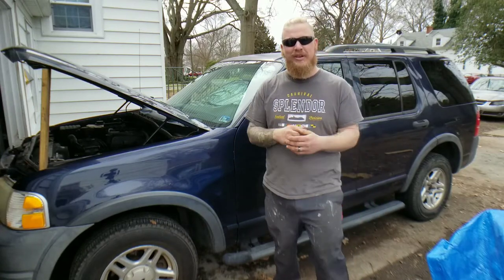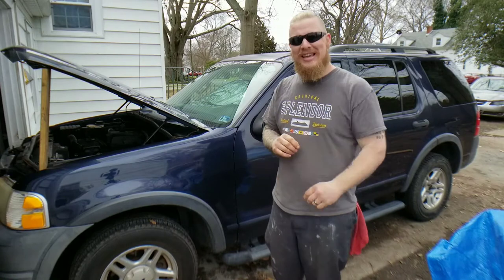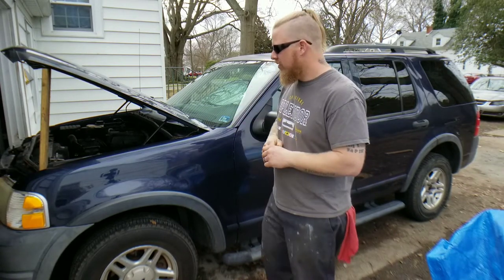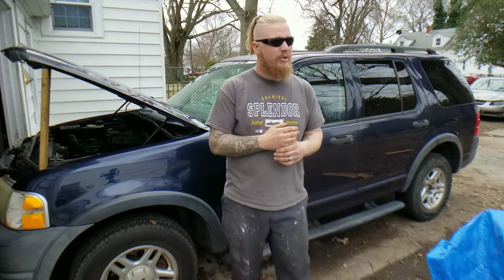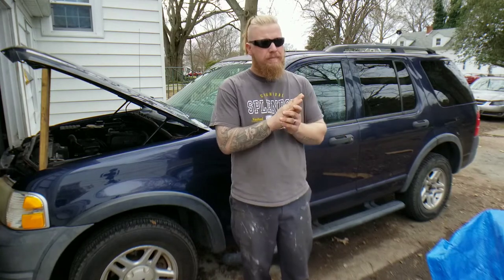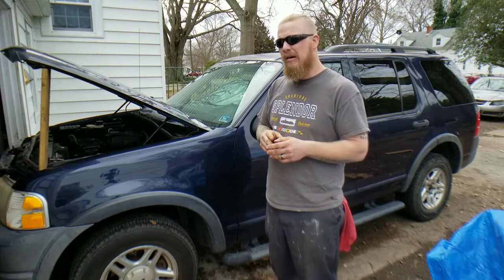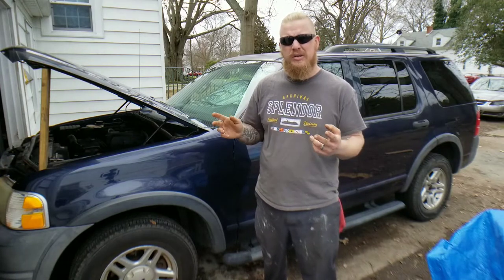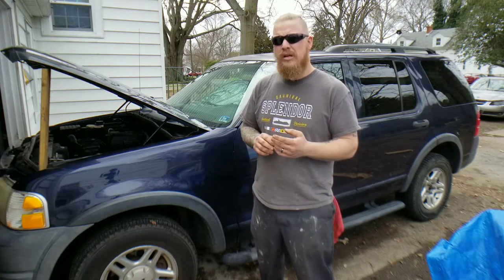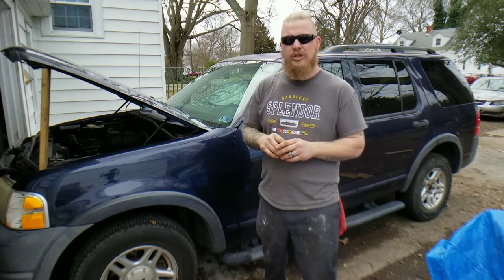Welcome back everyone to another great episode of Sell Those Flippin' Cars. I'm Zachary, and as I said, we are replacing the engine in the 2004 Ford Explorer. This model does have the V6 engine in it, which is fine — it's a very strong engine — but a customer was driving the vehicle and they heard a pop, and all of a sudden it's gone. Now, unlike when you have a head gasket pop, your oil is still good on this. It cranks, and it cranks fast too, but it doesn't do anything. It just cranks. It is receiving fuel, it is receiving spark, but it's not receiving fuel and spark at the right time when it's supposed to be.